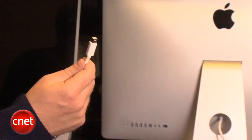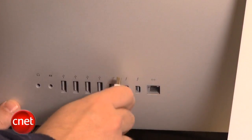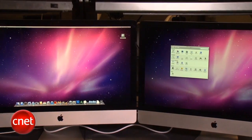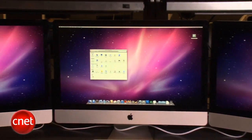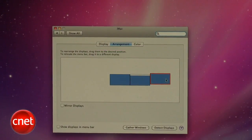We actually have a couple of extra 27-inch iMacs in the lab from older reviews. Because they can also work as standalone displays, we can actually show off the new iMac's ability to output to two other monitors. We have a couple of mini DisplayPort cables here, and that's compatible with Thunderbolt. When we connect these, the iMac will detect the other two monitors automatically and span the screen across to give you a nice giant workspace. Once you have the screens all connected, you just open up System Preferences and set the screens up in the order you'd like them to flow.